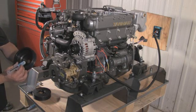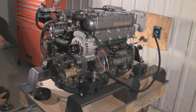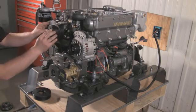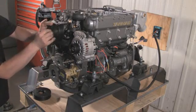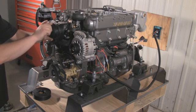Next, spread some barrier teff gel — that's included in the kit — on the inside bottom flange of the water pump, where it sits on the steel mounting surface like so. Also in the kit are four new replacement bolts that simply bolt in. Use the Allen key to put them in. It really is that simple.